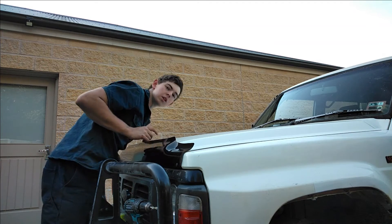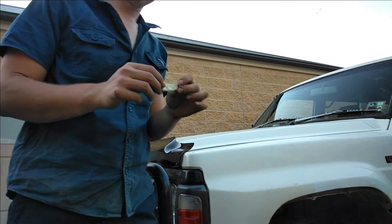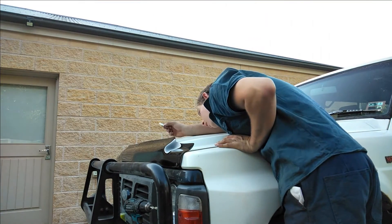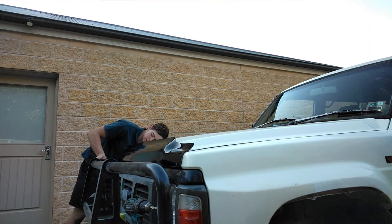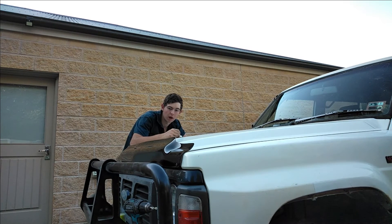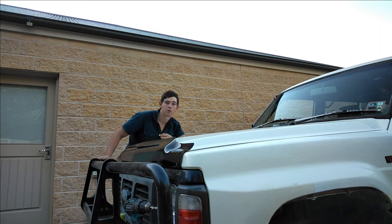Make sure it shuts. Next step — in your little bag of things you get these little anti-vibration pads. You want to look under your bonnet with the bonnet protector on, where it actually touches the bonnet. You don't want it rubbing on there, so wherever it touches you want to put one of these little pads under there just so it doesn't vibrate on the bonnet and rub the paint off. We're going to put some in the middle and one on the side where it sits up a bit.